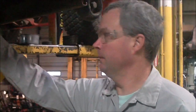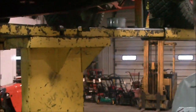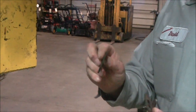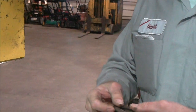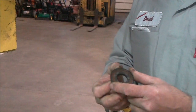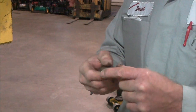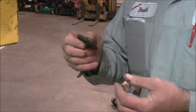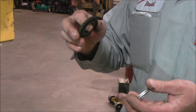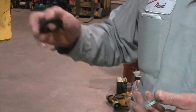After you've got your shaft done, your hex washer's ready, and your bolts ready, you want to look at the other two remaining parts. First of all, your washers. These are beveled washers. They've got a cup in them. This acts as your clutch mechanism in case you hit something. Instead of having a sudden jolt on your belt, it'll allow the blade to slip just a little bit. If they have spun, they've normally been hot, and they'll lose some of that cup. It's very important to have that. So if you're not sure, compare them to some of the other ones, and always get new if they're bad.